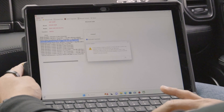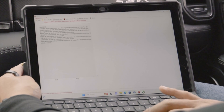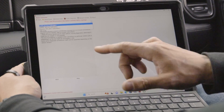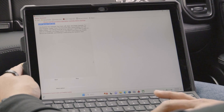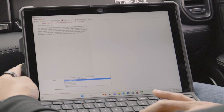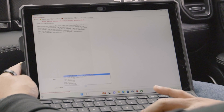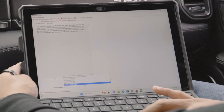Hit connect. Now that we're connected, we're going to go into Active Diagnostic up here at the top. The first one that you click from the scroll down is CVPM Service Calibration — you're going to hit that. Down at the bottom it's going to give you a bunch of options: there's Enforced Calibration Regardless of Camera State, Only Cameras with Invalid Calibration. You don't want to do any of those — you want to do Individual Cameras Only.